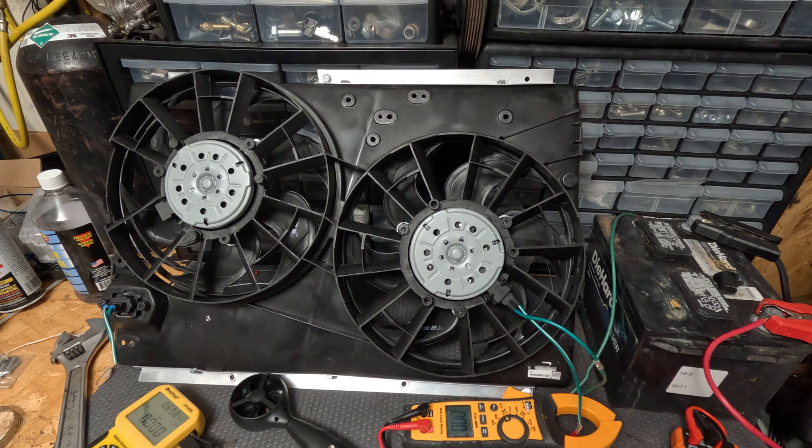Any of these fans, the thick radiators are going to kill them — they just can't do it. They'll flow well at zero pressure. You can look up static pressure drop — I'm reading this one but you can look it up. This particular fan is flowing 1,446 CFM at zero static pressure, and by half an inch of static pressure it drops to 750, at one inch it's down to 446, and at 1.2 inches it's down to zero — so it just fades right out.